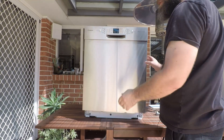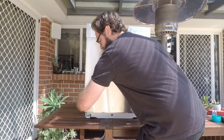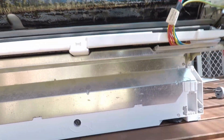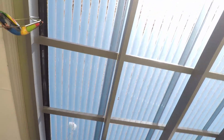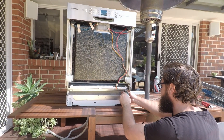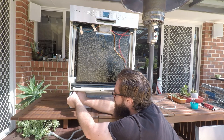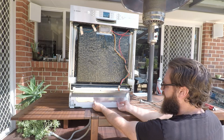Once they're out, close the door back up, grab around the bottom at the sides, and just pull outwards. Now you'll have access to the screws at the bottom — again, they're Torx T15 bits. Remove those and then you can just pull the panel out.